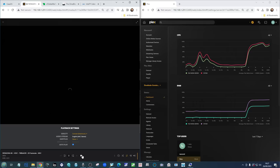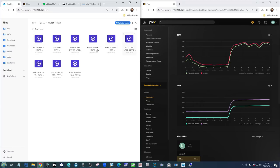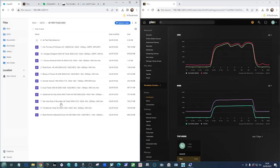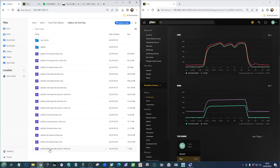For £64, it's not going to be a capable 8K media server — and that's fine. I've only ever found about four or five NAS devices that comfortably play 8K in Plex, due to both the compression technique requirements and the sheer scale of these files. The Patagonia file we tried is actually a 605 megabyte file that's 4 minutes 31 seconds long. To put that into perspective, the largest jellyfish file is 400 megabits per second — meaning 30 seconds of that file is 1.4 gigabytes.